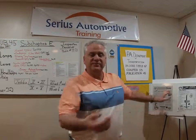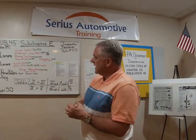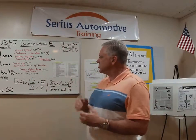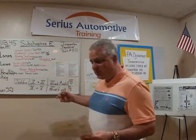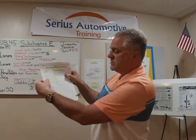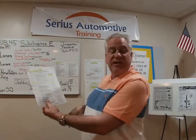You could still use the screen — no problem. We went over Subchapter E: lamps, lenses, and headlights. If you have any questions about the chart, you could Google it — it designates all the codes for the lights. The important thing to remember: for the purpose of today, I used Table 2 and 3 because my Hummer H2 is wider than 80 inches — it's a multi-purpose passenger vehicle — so it gives me the required lights, indicator lights, clearance lights, license plate lights, and the locations and heights of each light.